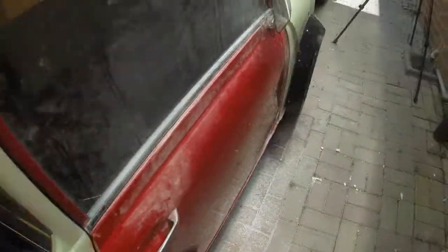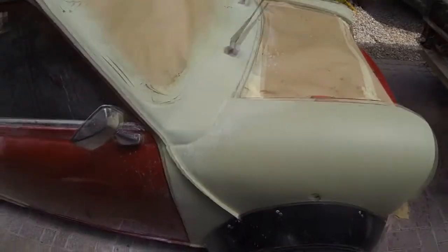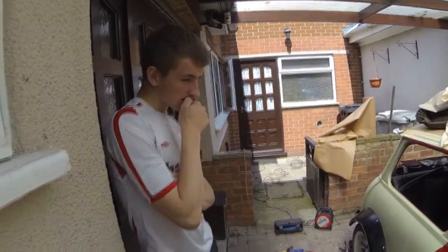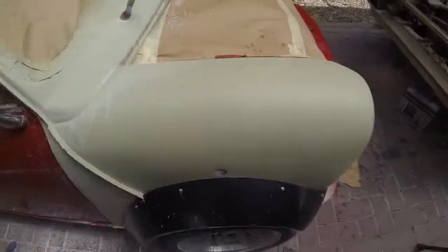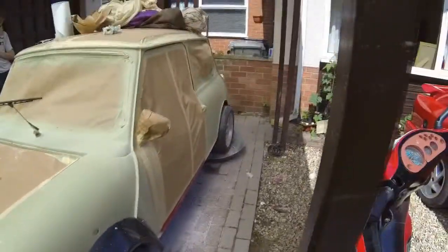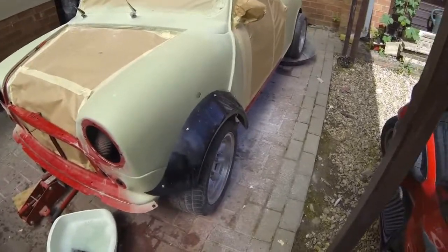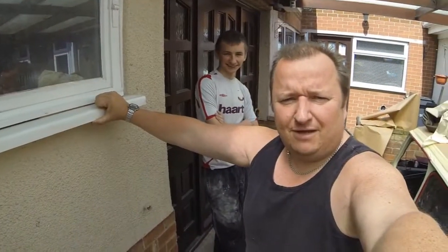Jimmy's just finishing off the flattened back of the paintwork. As you can see there's a lovely smooth finish he's got there now. He's going over with 600 wet paper - and you can probably hear that textured finish - and then back there, absolutely smooth, so that's ready now for base coat. We've just got to go around and do the whole car. Once I've got one more wheel arch to go - that back one over there - and once we know they all fit on nicely, they can all come off again and the rest of the car can be prepared for spraying.